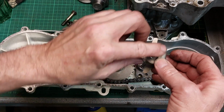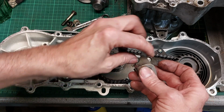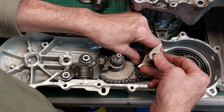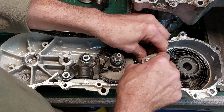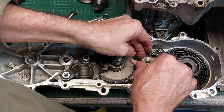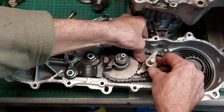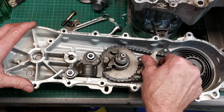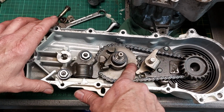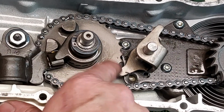This straight edged lobe goes against the starter lever at the back of the transmission, and then the crooked one with the sharp edge is the latching mechanism for the starter ratchet. Okay, so you push that down there, catch it on there, and normally when the camera's not going, you can get it on straight away. Like that. We'll just tuck it down. Hopefully it will stay there. There. Okay. So now that latches like that quite nicely, and it's what you need to do, says in the manual, you sort of pre-wind it a little bit so that that dot lines up with that tooth on the latch there. That's your start position for reassembling the transmission.